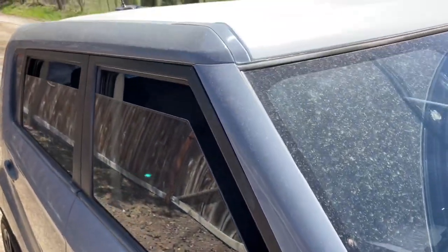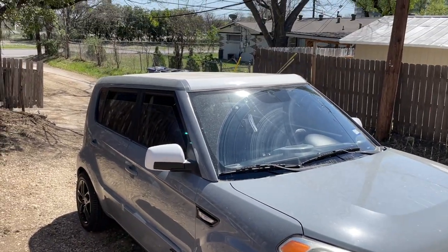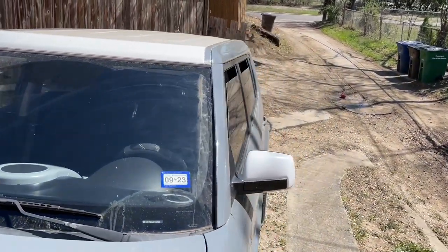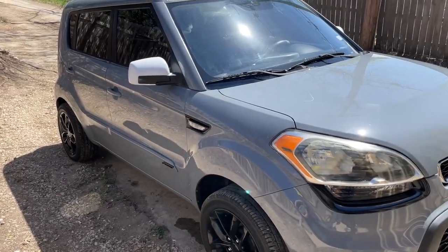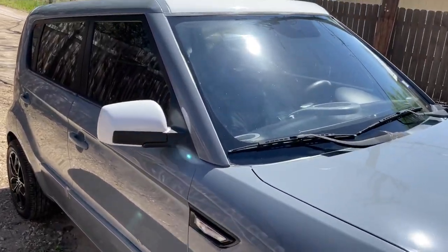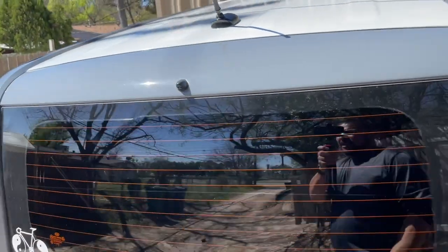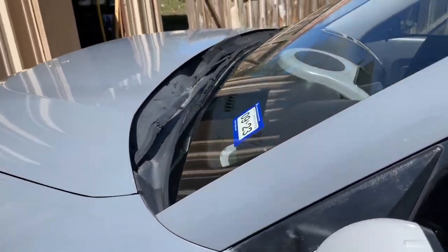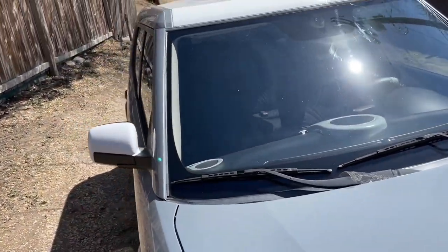We're going to paint the left and right mirrors and of course the roof — and that's how it looks before we get started. Quick correction though: I went ahead and decided to wash the car and dry it up. The reason is I realized that if the car was left dirty, the tape would have a hard time adhering to the surface. So now that it's all washed up, I'm going to continue with wiping it down with acetone, masking off everything I don't want overspray on, and then we'll go from there.